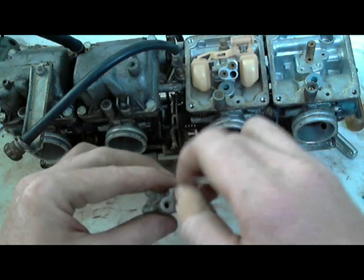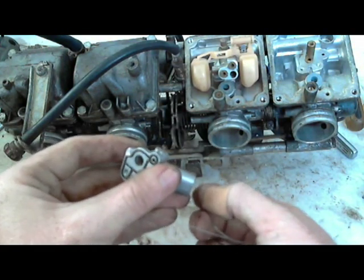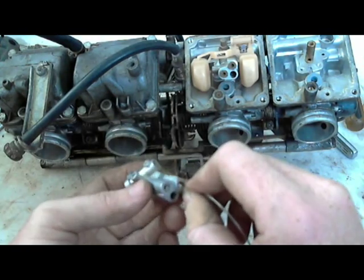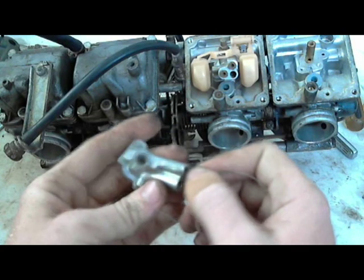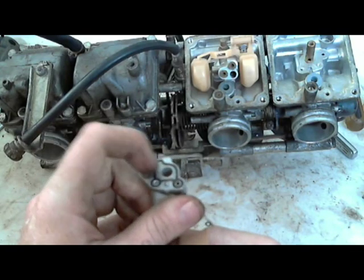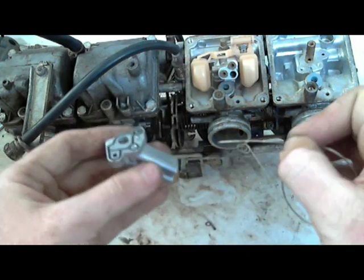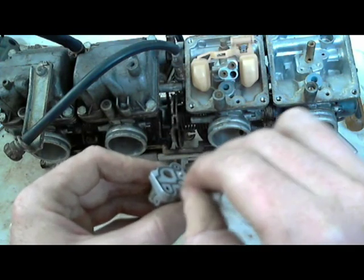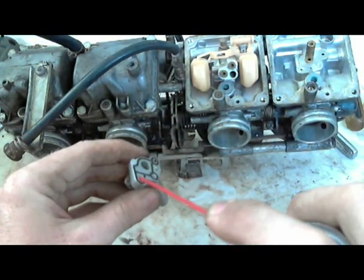Okay, there we go. Oh wait, no, that is the one that had the jet in it. The one below that's the one that didn't have a jet in it. So, yeah, I'm just poking it through, swirling it around. Sometimes it's a little hard to go through because there might be some buildup. Looks like that. So you can see where the carburetor cleaner started to come out after I sprayed it, which means it is going all the way through. But I like to usually poke through from both directions because that way you get all this stuff out. After I poke through it twice, once from each direction,